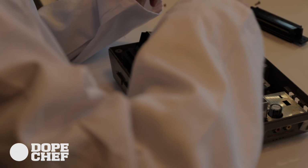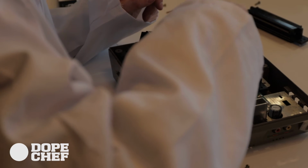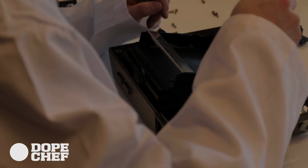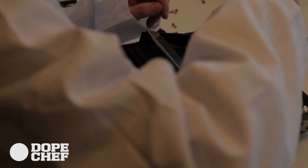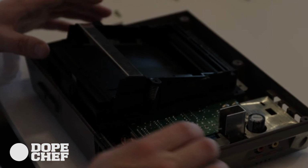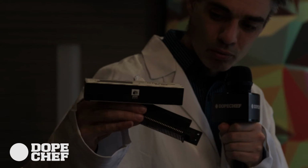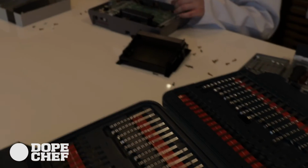Regardless, it'll look good in the box if we can't get it to work. But I think we got it. I have strong belief that the Nintendo will rise up and play again for many years, because I don't think it's the motherboard. It's always those little pin connectors that people said were the main problem over the years. So you would blow on it, or you would take a Q-tip with hydrogen peroxide and clean that. There's the old pin connector. This is the box the other system came out of. So very cheap, very affordable to get the repair kit online.